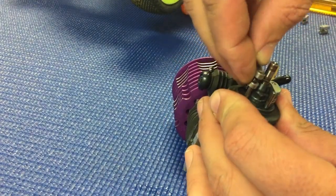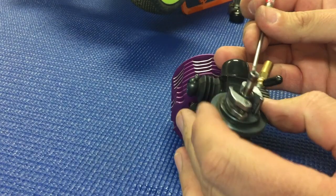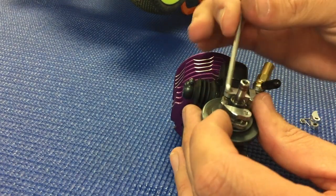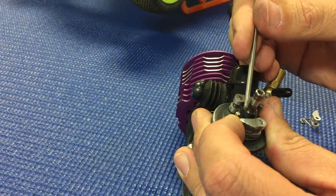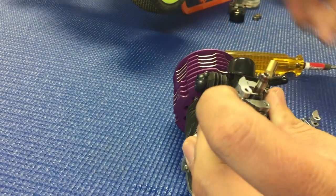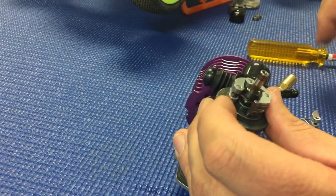And then with the 4-shoe clutch, I'll always install the second shoe directly across from the first shoe. It just makes it a lot easier to install. Now with the third shoe, and this is how it would be if you're using the 3-shoe clutch, you'll have to open up this second shoe before you put the third shoe on. And again, just push the spring out of the way, push it all the way down, and then you'll hear that spring snap into place.